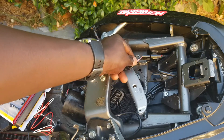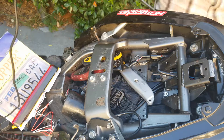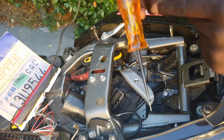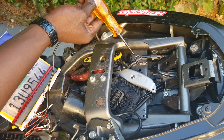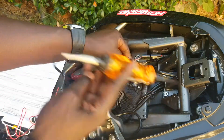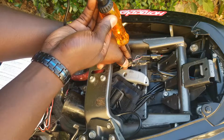I cut the wires off camera, so now I'm going to locate the positive and see which wire lights up the brakes. Turn the bike on. What will happen is you'll see a light once I connect it to any wire and then press the brakes. You see that? When I apply the brakes, you get the light — so that means this is the positive wire. Now we need to find the negative. When you do this... no light here. Yes, we have a light!